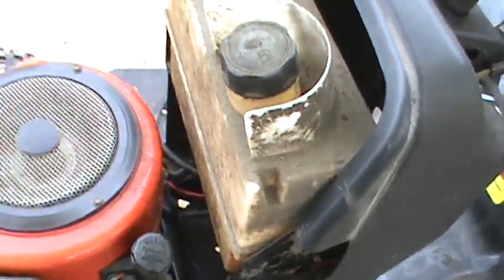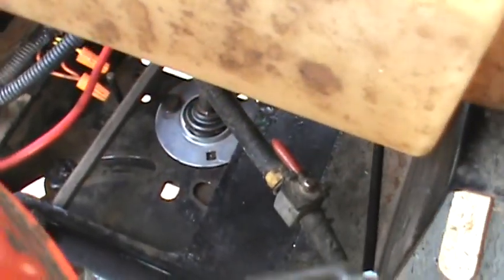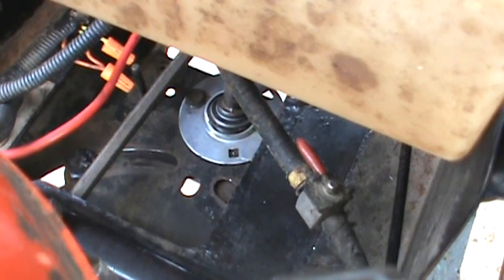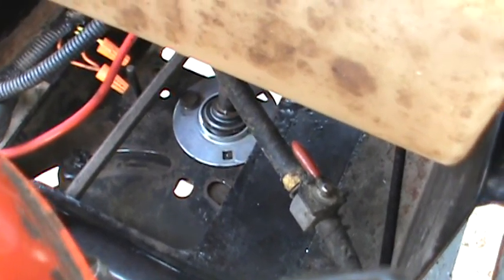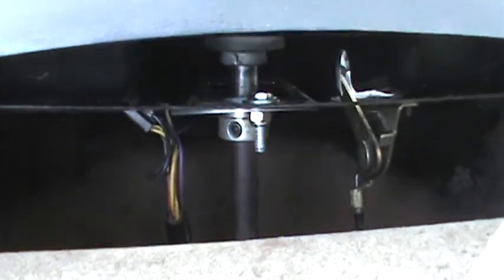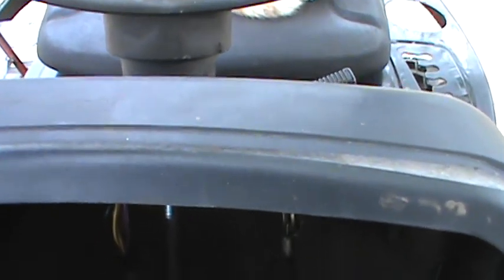I'm going to do a cold start here in a moment. With this ball bearing steering — you can see the lower retainer down there — the bearing is 1-3/8 by 5/8, commonly used as a high-speed wheel bearing. The circlip is left on there because it keeps it inside the flange. Once the flange is bolted down, and up top is bolted down also, you can see I have a locking collar there. After riding it a little bit, it does have a little bit of play there, and the collar needs to be adjusted.